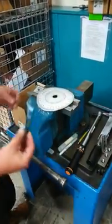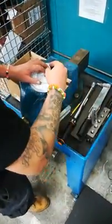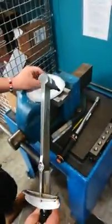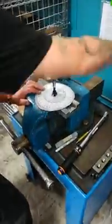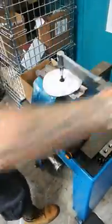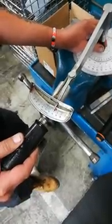Gonna get one of our freshly patched bolts and put my block back into the hole. What I have here is a 50 foot pound torque wrench, and what we do is we seat the bolt to 20 foot pounds before we start any of the actual torquing. We just seat the bolt to 20 foot pounds. My bolt's been seated to 20 foot pounds.